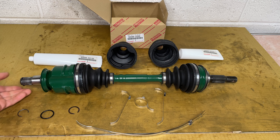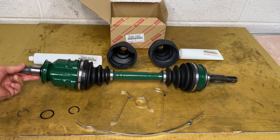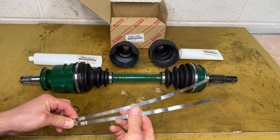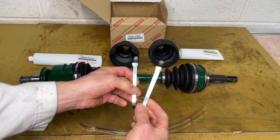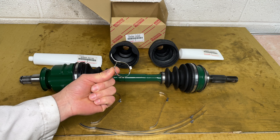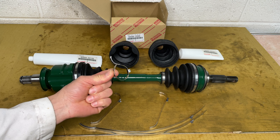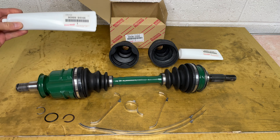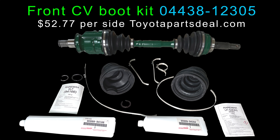Now it's time to rebuild one of the front axles. We know this is the right side because there is an o-ring right here. You know this is a CV boot kit for the front because the inner boot has this curved piece instead of flat. The longer bands are the same length for both sides; on the inside we have a longer band and a shorter band. This is the c-clip that holds the bearings; this is the o-ring that goes right here and this is the clip that holds it into the transfer case. The bigger tube of grease goes on the inner CV joint and the smaller grease goes on the outer CV joint. The CV boot rebuild kit for the front is also available from Toyota Parts Deal or your local Toyota dealer. Make sure your Toyota axles don't have any play when you twist them — if your axles are loose, go get some better ones from the junkyard and rebuild those instead.